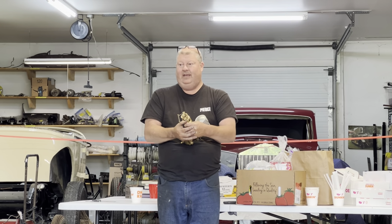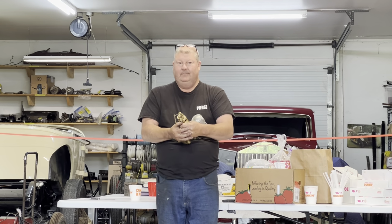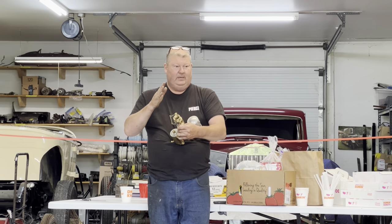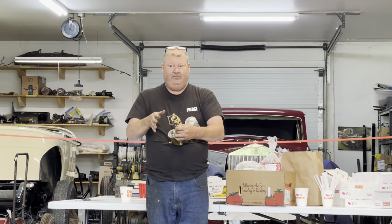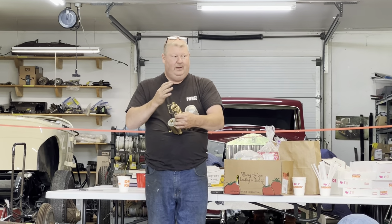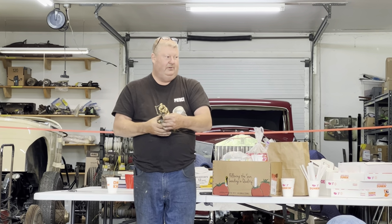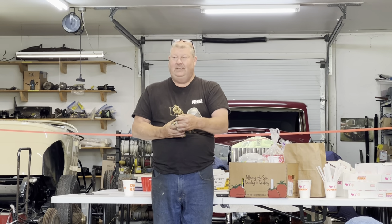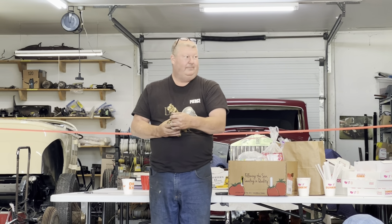It really is that simple. And again, it's just remembering that when you stomp on it, if you get a little backfire and a stumble, leaned out, that's right about where you want to be. A hair richer than that, and you're adjusted in. Yep, easy peasy.